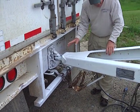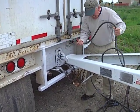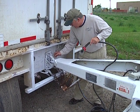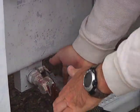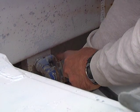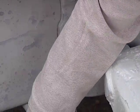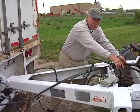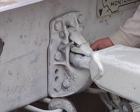The next step is the connecting of the air lines. We will connect the emergency line first, then connect the service line, and then supply the emergency air to the trailer, which will activate the plunger on the I-hook. So first I'll connect the emergency line to the converter dolly, then take the service line and connect that to the converter dolly as well. Now I have the service line and the emergency line to the converter dolly, and another emergency and service line that will connect over to the trailer. Then I will supply air through the emergency line to the trailer.